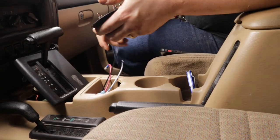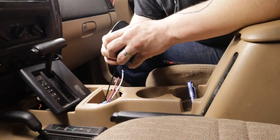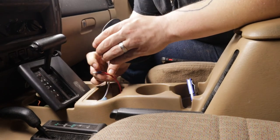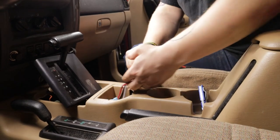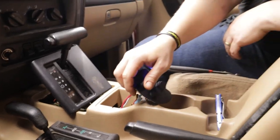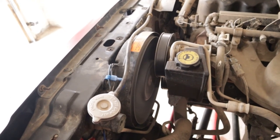So we got the little switch here — black at the top, white in the middle, red at the bottom. I'll connect it to the switch, then go back into the engine bay and connect the wire to the battery. Flip the switch, and just like that the fan works! Turn it off — you can see just like that the switch works and the fan kicks on. And that right there is how you use the K Suspension fan relay wiring kit. If you'd like to get one for yourself, go ahead and click the link in the description below.